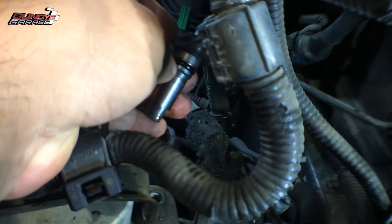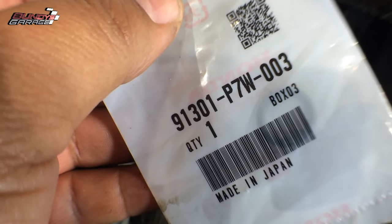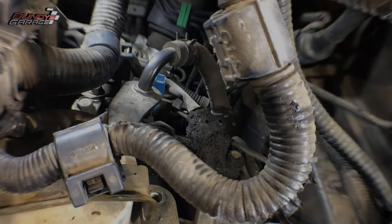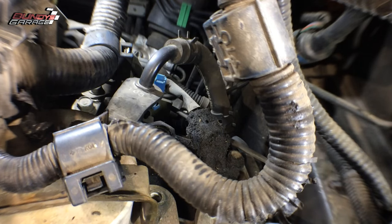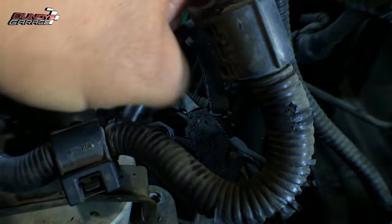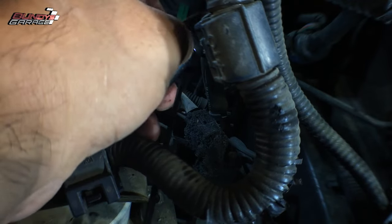I want to get this o-ring replaced while we're here. It's right there where my thumb's at — just get a little pick tool and pull that off. I have the new one here in hand, picked this up from the Honda dealership. Part number 91301-P7W-003 is the o-ring that you need. If it's available on Amazon I'll put a link down in the description below. I'm going to take this o-ring out right at the very top using a pick tool.